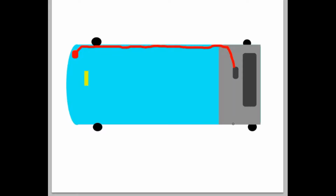Another wire you'll have, of course, that goes with this is your ground. Your ground will most likely be a brown wire if you're buying one of the kits that has all the wires in it, like I mentioned. But like I said, the colors of wires don't really matter, it just makes it a little bit easier, so I'm going off of those colors. The brown wire, you could either run it off the negative side of your battery. What most people do is they'll find a good metal bolt in their trunk, and they'll run it from there. Your ground will run from that bolt, and it too will hook to your amp in the negative spot.